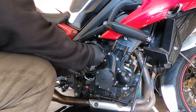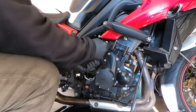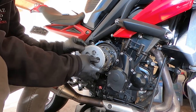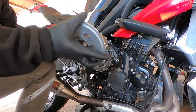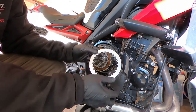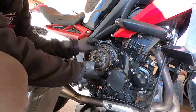We'll start by breaking loose the bolts on the pressure plate in a star pattern, which will allow us to release the pressure on the plates evenly. We'll continue to loosen and remove the bolts in a star pattern, then take the pressure plate off. The A plate is stuck to the pressure plate, so we'll take that one off too. After we remove the A plate, we'll come to our first steel plate. The steel plates have a flat side — the flat side needs to go toward the clutch side — and a beveled side, which needs to go toward the engine side when reinstalling. Now we'll move along and start removing the steel plates and friction plates.